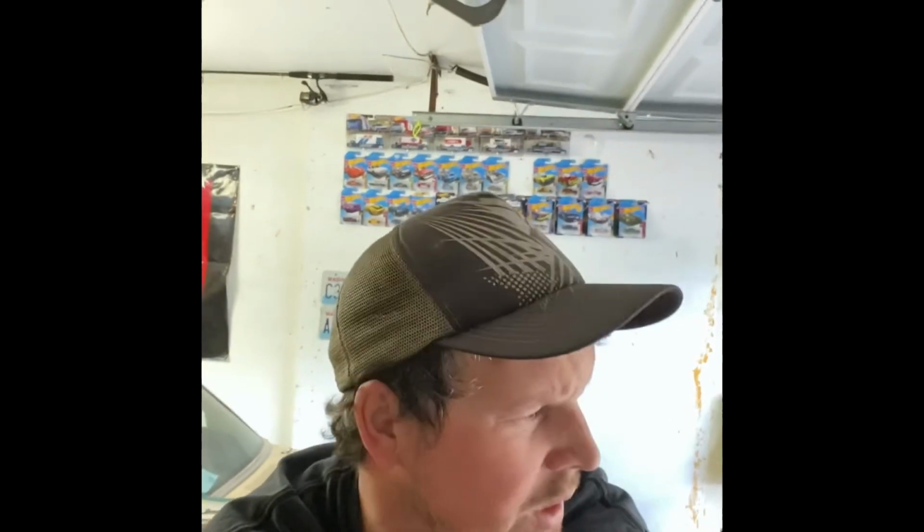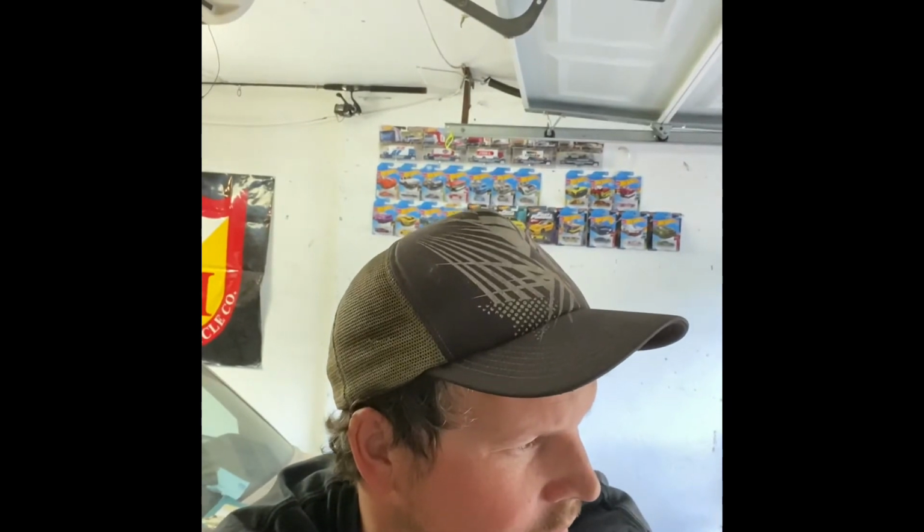They're supposed to be a good tire, but I had a lot of issues with the car, with the clutch when I was at the park. So there was a lot of cool down time between runs, and the tires started chunking. I think that's why. It's mainly my fault. I didn't drive on them hard enough to get the most out of them. I was driving on them, stopping, driving on them, stopping, and then they started chunking. I wanted to avoid that, so I'm trying the Federals, and then I'm just going to keep playing with tires until I find the ones I like the best, or that work for me in the 4AGE car.